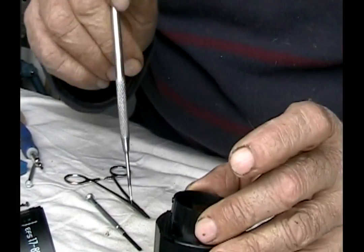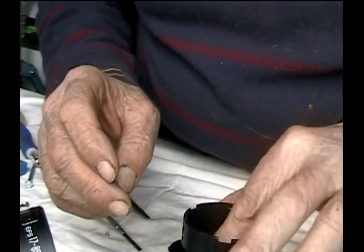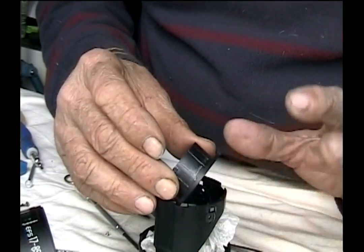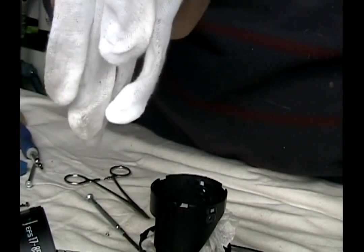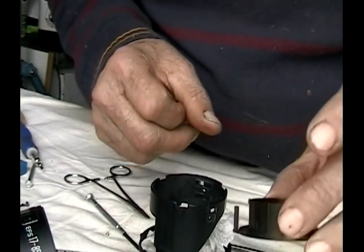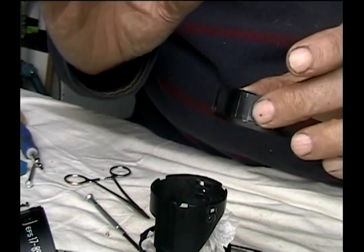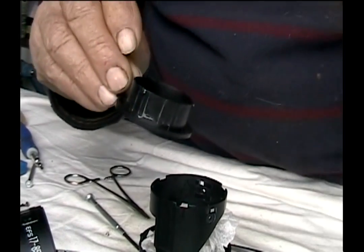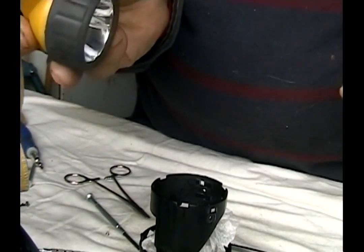When you're disassembling or reassembling, what I did was put some lens tissue down in the bottom before setting this in so that it doesn't drop directly on the glass. Also, something really good to have is fine cloth gloves like they use for handling film — saves you a multitude of evils. Also check your optics and make sure you have good lens cleaning equipment, because even being really careful I still found fingerprints on the glass just from working with it.